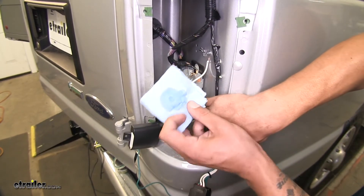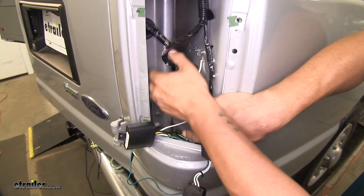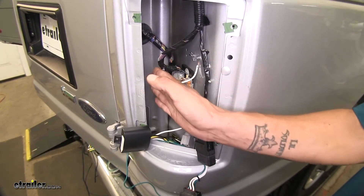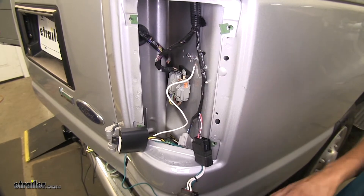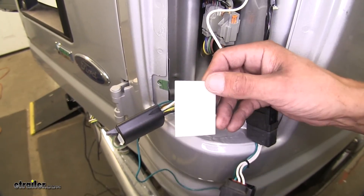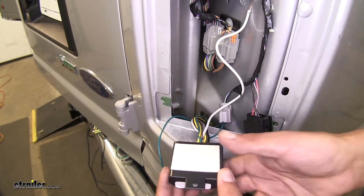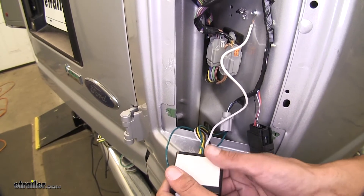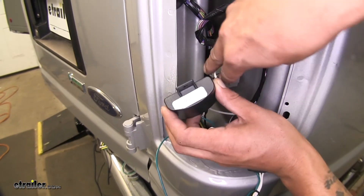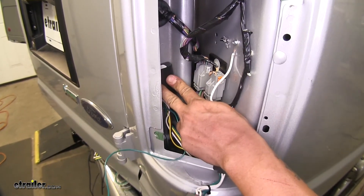I took some alcohol and a paper towel and I'm just going to rub the inside of where I'm going to mount the box so it's nice and clean. Right inside the taillight area, just towards the center would be a good spot because we know it's going to be out of the way, but there's still plenty of room. So we can take our double-sided tape, take one end of the backing off, and apply it directly to the module. Push pretty firmly to make sure the glue sticks nice and good, then peel off the other backing. Once we get it into where we want it, give it a nice little push to make sure it adheres.